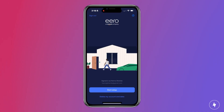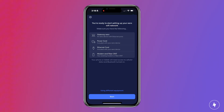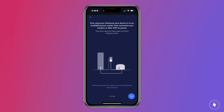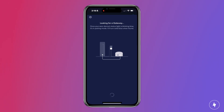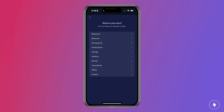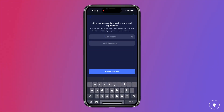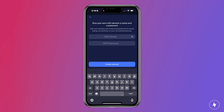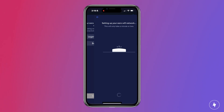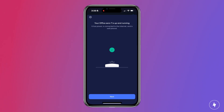Once you go ahead and get your Eero app downloaded on your mobile device and open it, it's going to make sure you have all of the components needed to successfully set up your Eero 7. First things first, you're going to unplug your old modem and old router from power. Then you're going to connect your Eero device to your modem using the Ethernet cable that came in the box. It's going to look for a gateway and you want to make sure your Eero turns green — that ensures there is a connection. You'll give it a Wi-Fi name and choose a Wi-Fi password. Once it's set up, it's usually a pretty quick process and it'll tell you the Eero is up and running.